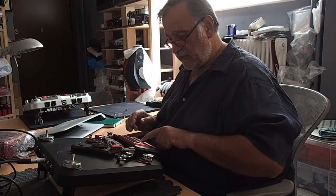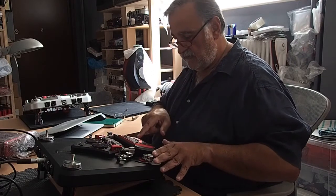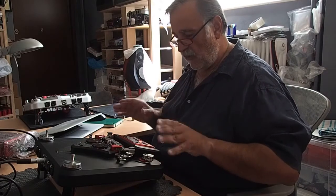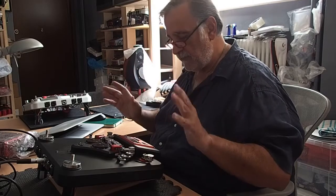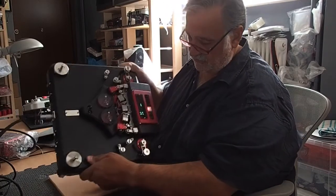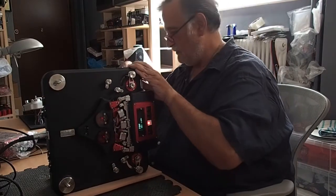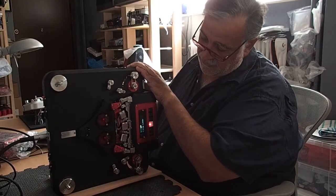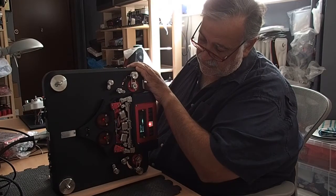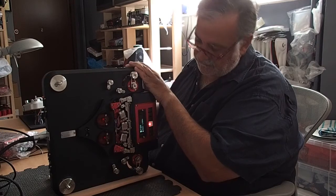With stop pressed, the tensiometer readings are 2.56 and 1.84. They should both be around 1.02 to 1.04. We spin the machine on its side and on the 1.84 tensiometer, we turn the pot itself until it gets to around 1.05. Here it's coming down — about 1.03, which is as good as we need.